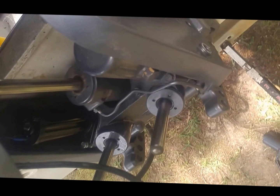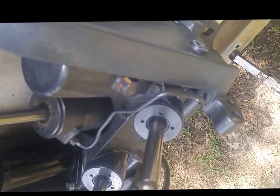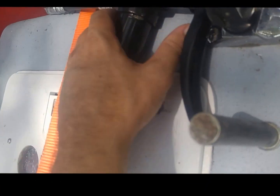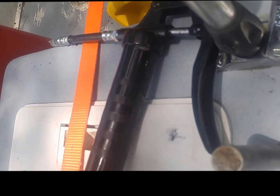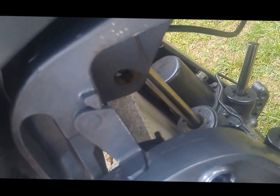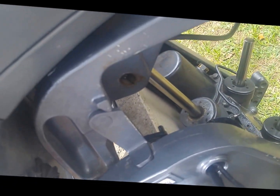And then I guess we'll give it a try. We've already hooked up our lines, our wires, put the boots back on, all that. Yeah, we're close. So basically now it's just the reverse of everything that you undid. Do these 6 bolts first, then the pin, and you're going to want to clean all the old crud out of here, and then use some good outboard grease, some sort of waterproof grease. I think that's Quicksilver. Coat the outside of that pin, maybe a little inside of these bushings, because you want that to definitely be well lubricated.